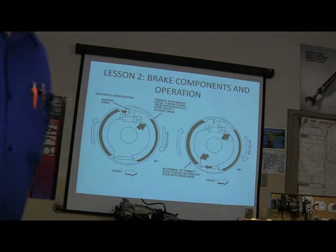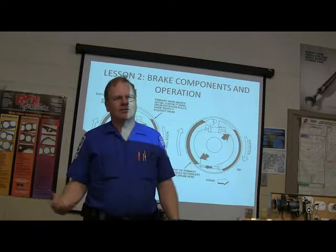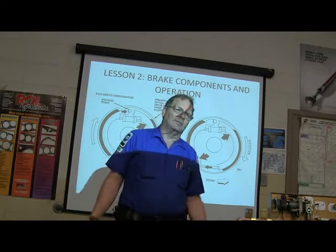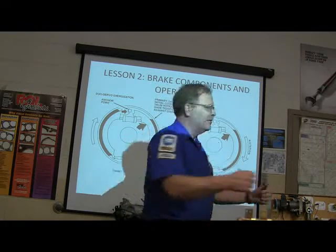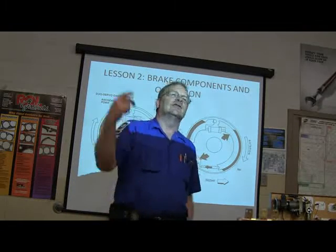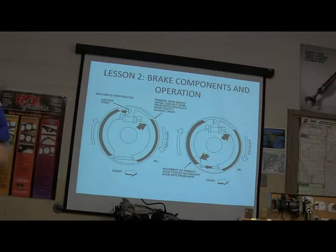All right. This one guy told me that this Cajun guy that he knew called, and he says that he had a Chevrolet truck that had drum brakes all the way around. It was an older Chevrolet truck. And he says, when I drive this thing and I hit the brakes, I go back where I come from. And he said, I don't know what you're talking about. So he goes and he gets in the truck and he heads off down the street. And he says, as soon as I mash the brake, the truck slides around, does a 180. When he pulled all the wheels off, he had put the short shoes on the right front and left rear, and the long shoes on the left front and right rear. So basically, he had really good brakes, better than he needed, on two wheels, and lousy brakes on the other ones. All right.